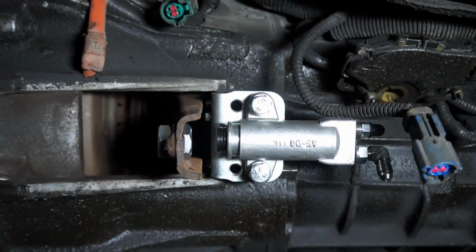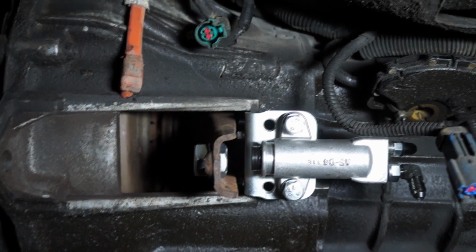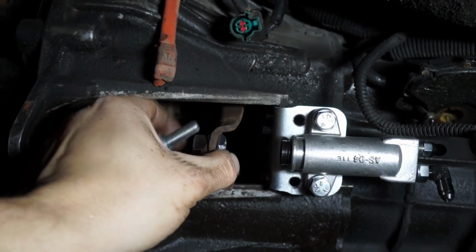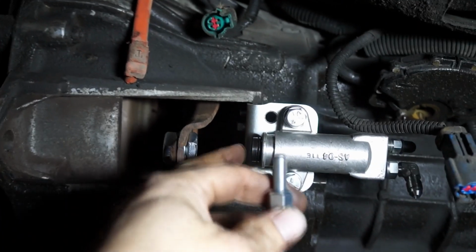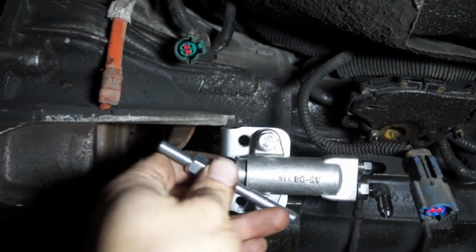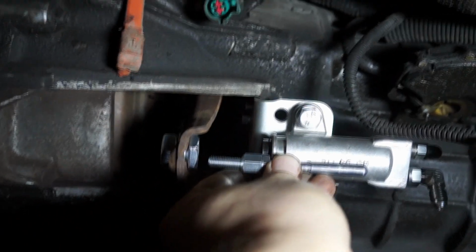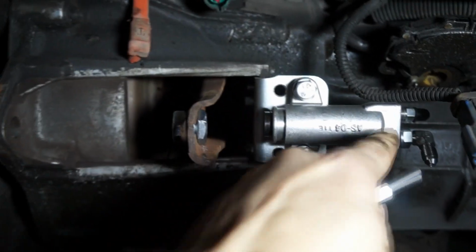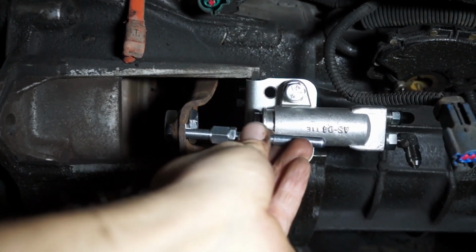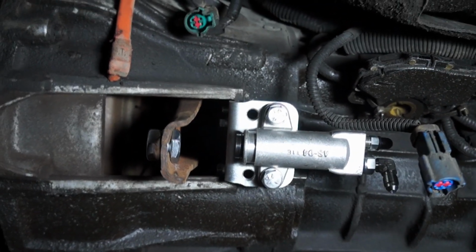Now if you're using, just like in this case, a clutch kit that has the fingers going inward, the issue we're facing is that by the time the fork and the bearing are making contact, if we leave the slave at the normal position, once again with the piston bottomed out, we are running out of travel. That means the piston will actually have to move like a third before it makes contact. So you're losing stroke right here. You're losing a lot of stroke.